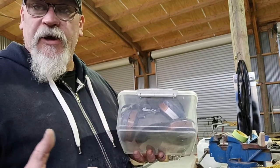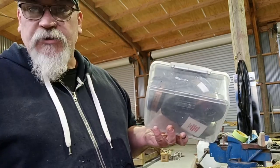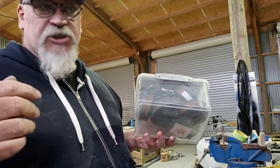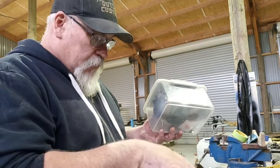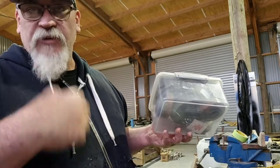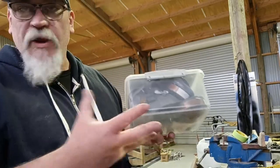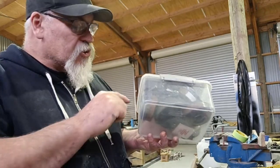basically they'll keep working, and then after 8 hours of being out of the box, they'll basically stop filtering the paint stuff, and it will actually end up in your lungs slowly, obviously. Still better than wearing nothing, but you need to change these regularly.